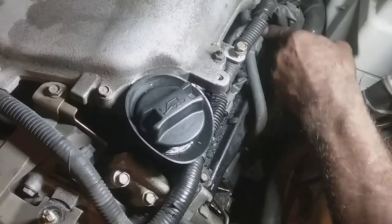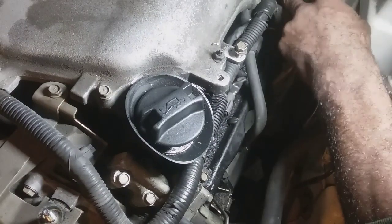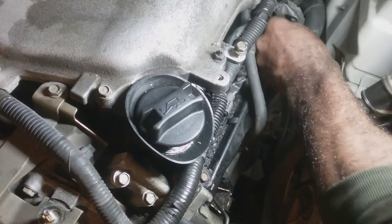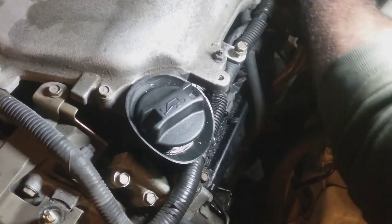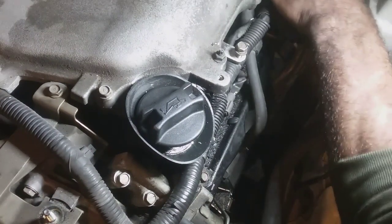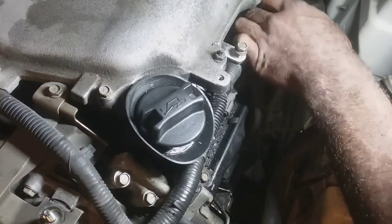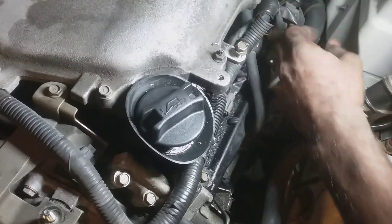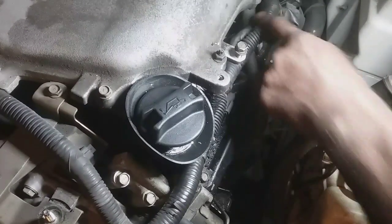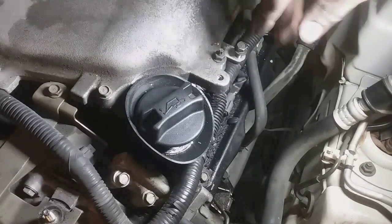So, you know, we can look at the coils here, make sure everything's connected, and which they should be, because you know it wasn't a hard misfire. Where's that? Here we go. Couldn't even find out where I was going. So make sure the coil's not broken. So I'm gonna keep on pulling all this stuff off, so we can get the valve covers moved, and then when we get adequate space, pull those out comfortably.